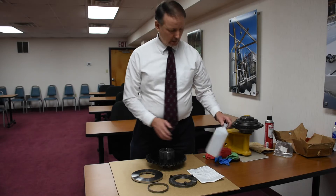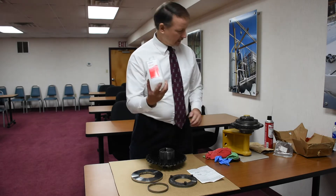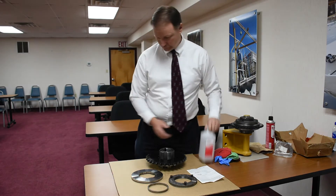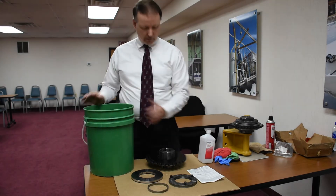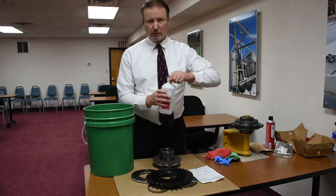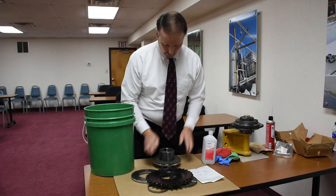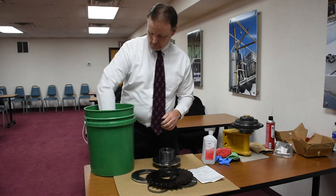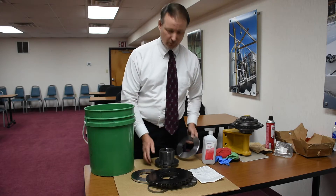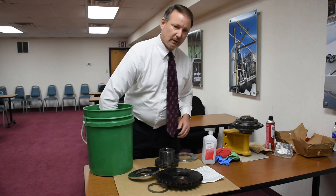The first thing we're going to do is clean things thoroughly. You can use two solvents if you want. This is 91% isopropyl alcohol — I like this stuff, it's easier to work with and it doesn't smell that bad. You can also use brake clean — your choice. To do it perfectly, because we do have friction discs which are a coarse substance, I prefer to pour a little bit of rubbing alcohol into a five gallon bucket. We're going to let these soak just in case somebody got their fingers on them, or because there's a lot of oil and grease on the chains. These are machine surfaces and this entire unit comes with a little bit of oil on it, so we want to make sure there's no contamination of the friction discs.